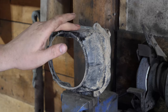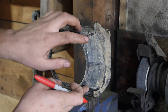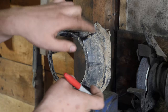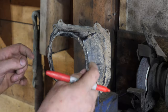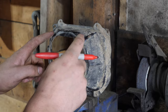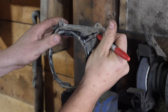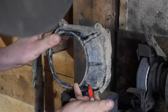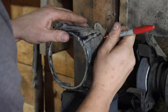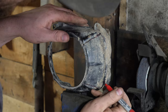Now that we know these housings can be modified, I'll show you exactly what I did. We want to retain these factory ridges because they ride on little plastic bits inside the rad support, and when you adjust the headlight alignment screws it moves back and forth on these ridges. I took my grinder and cut back on each of these, and then this whole front face connecting the ridges also needs to get cut out.